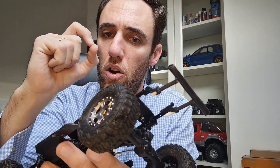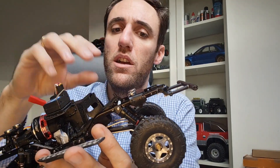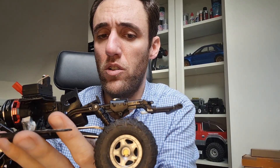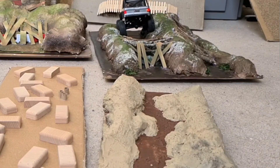Unfortunately, I didn't manage to get it sealed because no matter if I was using 2.5mm O-rings or 2.0mm O-rings in place, it was always leaking some oil — even using 200 CST oil, 300, 400, it doesn't matter. So in the end, instead of filling it with oil, I just put a couple of drops of heavy oil, like 400 CST viscosity oil, which is heavy enough. It's not leaking so much, but it's still actuating like an oil shock and it's dampening way better, as you can also see in these videos.